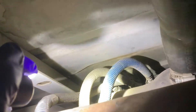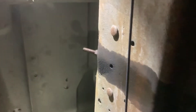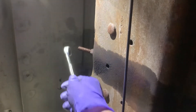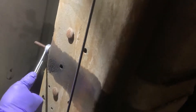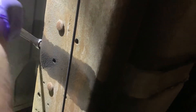To be able to remove the fuel hoses I think we can just drop the tank down some and that should give us enough room up there. Before we support the tank let's go ahead and make sure we can crack these nuts loose. 5/8ths was a bit too big on here and 9/16ths didn't fit, and I found 15 millimeter is the closest I can get even though it's a little bit loose. It's probably gonna take a while to get these all the way off of here.